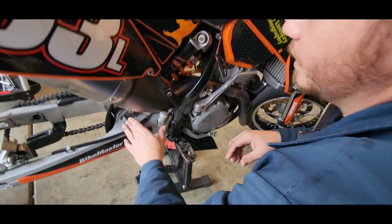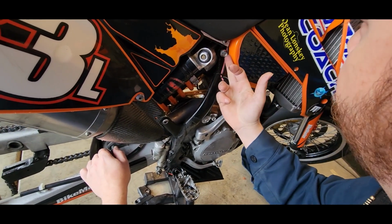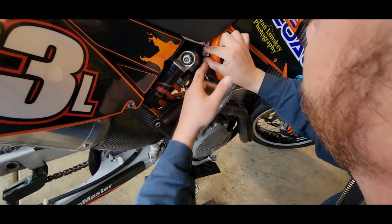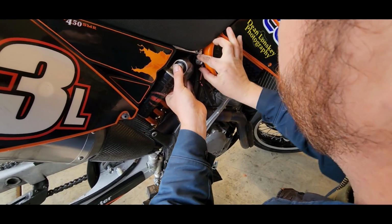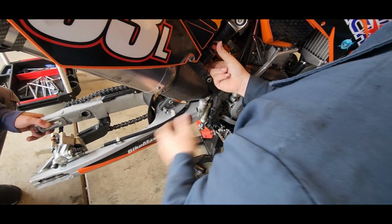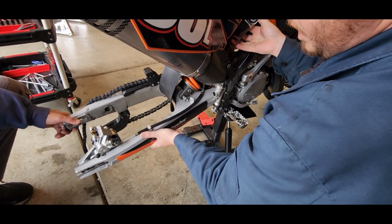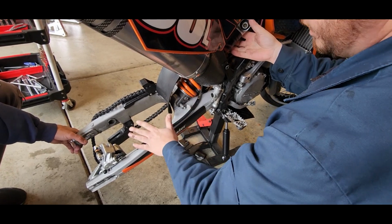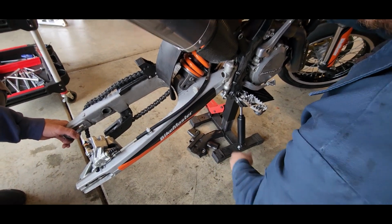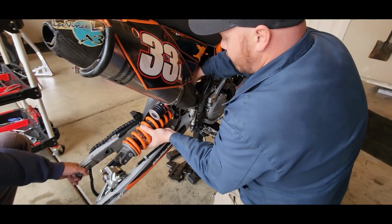First thing you'll want to do is take this one loose. Just crack it loose so that it's able to turn a little bit once you get everything else out. Once you get this bolt all the way out, the reason we did this is so you don't have to fight the swing arm bouncing everything around. So once this bolt's all the way removed, you just got to wiggle it a little bit and you should be able to get this bolt right on out. It helps to have a second person support the swing arm while you're doing that, because a lot of times that'll bind in there. So once you get that free, you just let the swing arm down and it'll let the shock back, and you let the swing arm rest on the stop. Grab the top of the shock, give it a small wiggle, and the lower bolt should come right on out. Once you have that, I find it easiest just to lift this straight up, and then your rear shock comes right on out.